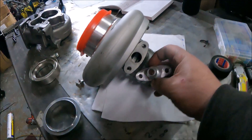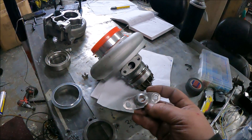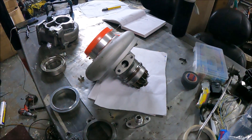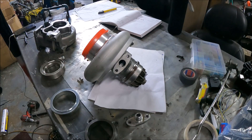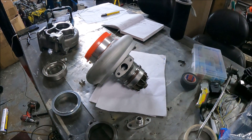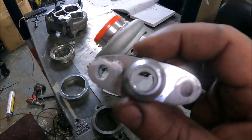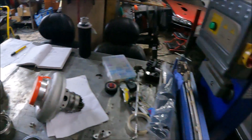It measures 11mm, 10.5mm — literally half the size. Absolute rubbish. If you put this on with no changes it's going to smoke, it's not going to be good — you'll end up with a smoky, leaky turbo. This is why I generally get a piece of metal pipe and rubber hose and make my own return, because these dash fittings, as pretty as they look, are just not big enough. Simple as that.